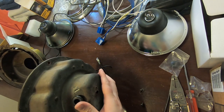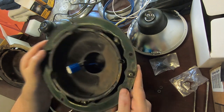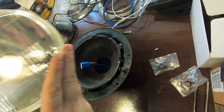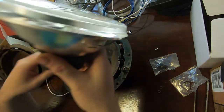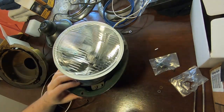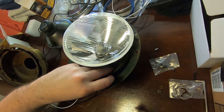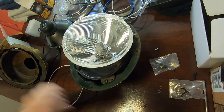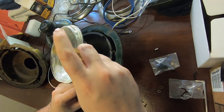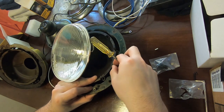I'm gonna go ahead and add some grommets to these, because since I'm doing electrical stuff, why not? One of those finally grounded down. Let's go ahead and install the light. Let's use the top so it goes this way. I am so thankful that both of the people who provided me with these spare headlight buckets for this project were kind enough to include complete ones. This includes a retaining ring and these three tiny screws that hold said retaining ring. That really made this project possible.